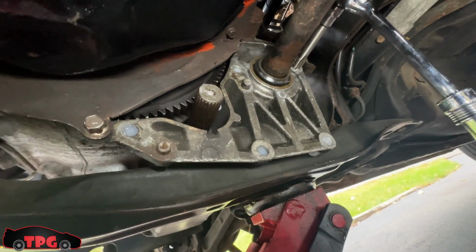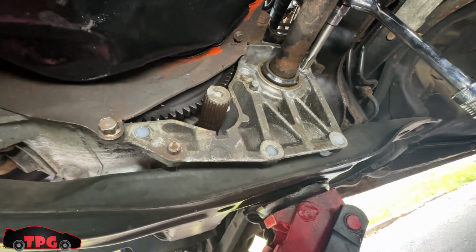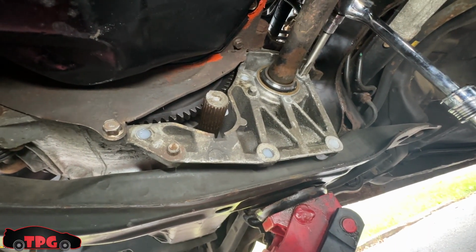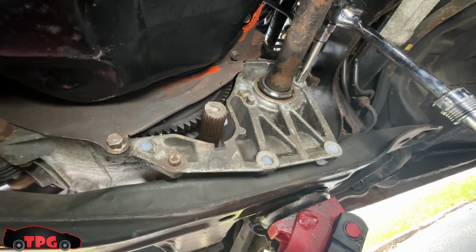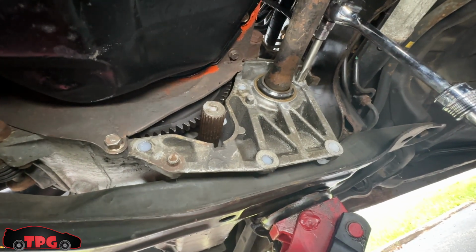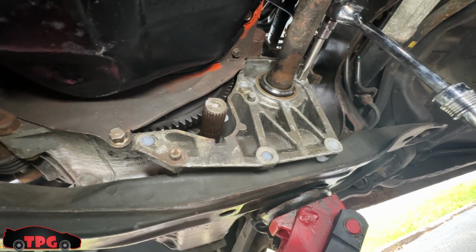But once you drill out the holes to accept the helicoil, you run your tap through it, then you clean everything, all right? Get it all nice and clean, brake clean it, get all the grease out of there, get it nice and dry, no oil, get it free of grit and grime, and then you add some red thread locker, or red Loctite, and you put that on the outside of the helicoil, you start it, screw it all the way in, and then you break off the tab, etc., and then you have a new bolt hole. Also, these are good because you can snip them to cut them to length.